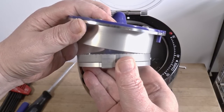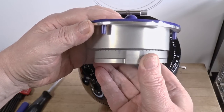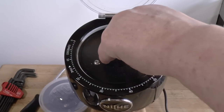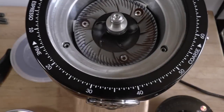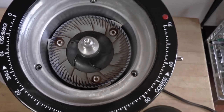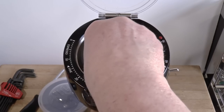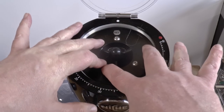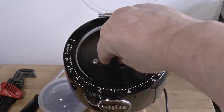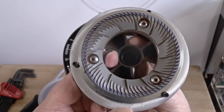A wide gap on the opposite side lets big particles pass. A clamshell effect like this makes it almost impossible to dial in espresso or Turkish coffee, so in that case you'd need to start shimming. But don't waste hours trying to align them to within a tenth of a millimeter — you're chasing a platonic ideal that really is imaginary. If the burrs are adjustable, there will be play, and the coffee is going to deflect them. But these are nicely parallel, suggesting very high standards of manufacturing and assembly. This is what I want to see.